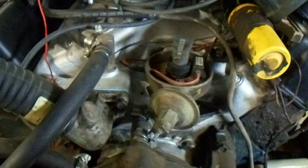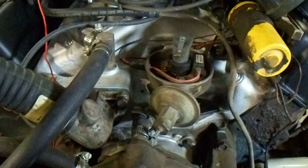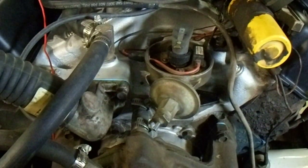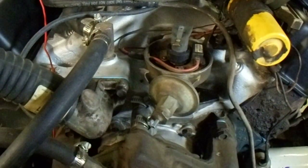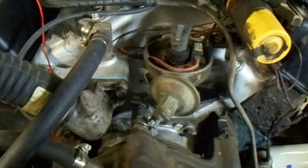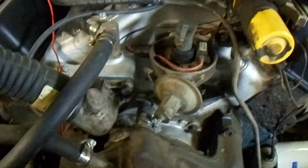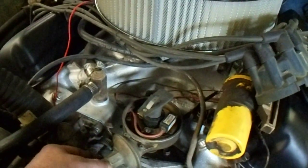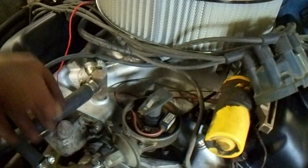What I found was that I was only getting about 32 degrees of total ignition timing at 3,000 RPM, which was not quite enough. What we're actually looking for here is somewhere around 42 degrees give or take at 3,000 RPM, with vacuum and mechanical advance all pulled in. My timing wasn't pulling in as far as I wanted.